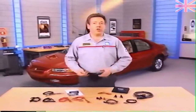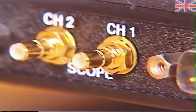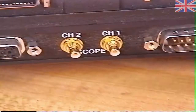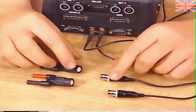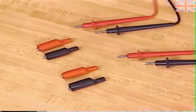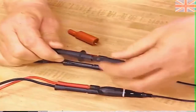Let's take a look at the items in the PEP module accessory kit used with the DRB-3 in dual-channel lab scope mode. The SMB connectors on the top of the PEP module are labeled for easy hookup and are gold-plated for superior conductivity and corrosion resistance. The two scope input cables, one for each channel, are approximately six feet in length and connect to the SMB connectors with an audible click. There are two cable-to-probe adapters that attach to the scope input cables by means of twist-lock BNC connectors. The accessory kit also includes two pairs of test leads and alligator clips. The test leads connect to the cable-to-probe adapters, and alligator clips can screw onto the test leads for hands-free probing.